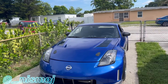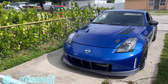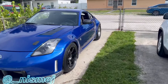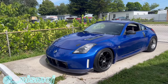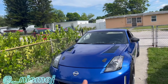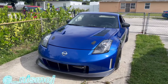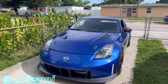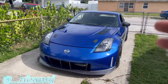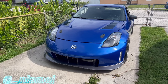This is about two days later — I fixed all my leaks. I also deleted my blow-off valve. You might say, 'why would you delete the blow-off? It's probably bad for your turbo.' But these new modern turbos — mine specifically — have anti-surge housing, so it's really not going to damage the turbo. I did my research before doing this.